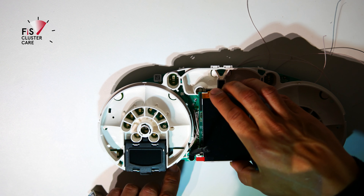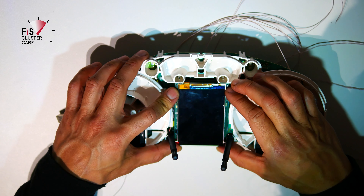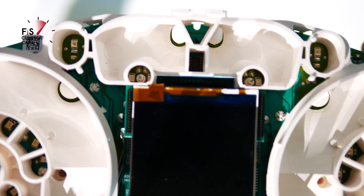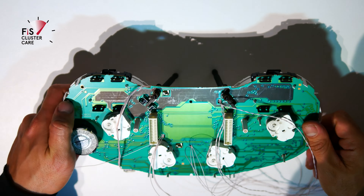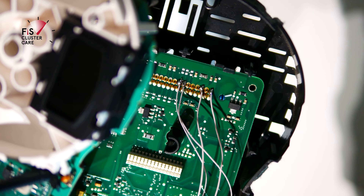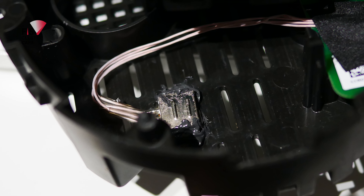The USB wires should be placed to the left of the left control stick. Test the fitment of the ColorMFA assembly by placing it upside down — this is key, as the firmware for the Audi TT Mark II flips the screen 180 degrees. Butt the connector end of the ColorMFA to the bottom of the white frame ensuring it's centralized. Once happy with placement, remove the screen to access the pins. Bring back the rear half of the board and solder the ColorMFA wires into place as per the wiring diagrams. Ensure you make a cut in the rear of the cluster housing for the USB port and stick it down.